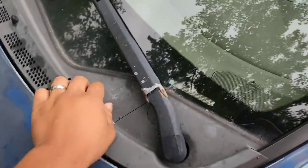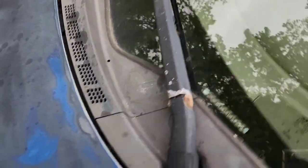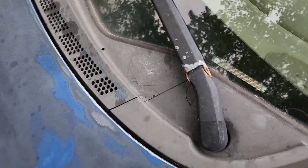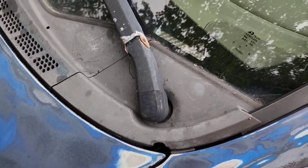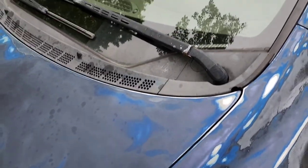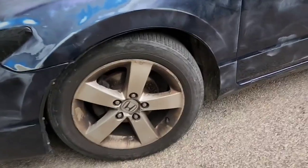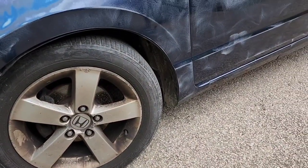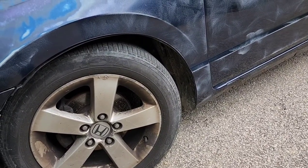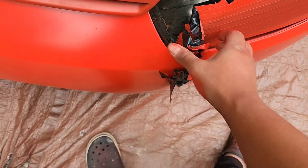First, like a cowl here, and extra screw here, and wipers. I'm gonna have to repaint this anyways. They look really worn and tired, and well, they just look ugly. So therefore, I'm not gonna mask it, because I'm gonna have to spray it black anyways, in which I'm gonna use matte black color for that one. And the gloss black is for the wheels. Obviously these wheels are also tired and worn out, and I'm gonna use the paint stripper to strip the paint down to the bare metal, and if there's any residue or paint left, I'm gonna have to sand it down. So this is the reason why I use electrical tape.